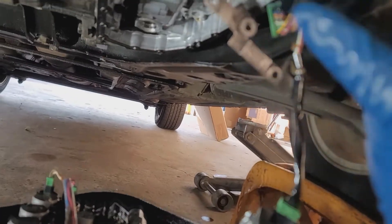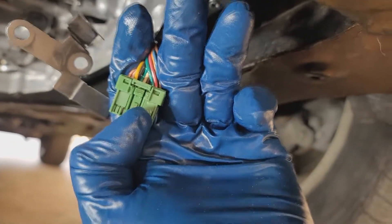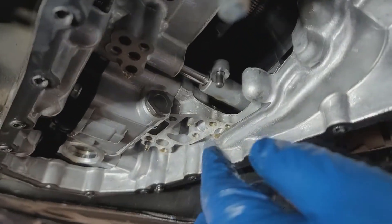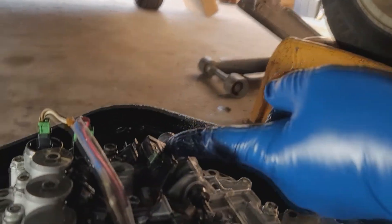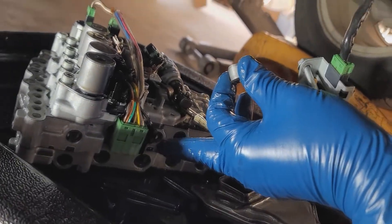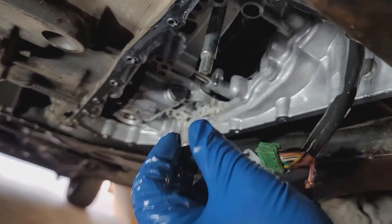Got the valve body off. Just a couple of things — it's a real quick connector, real easy, standard. Little tab, you push down, it connects right here, very easy to come off. This tab here needs to engage up here — that's where it pivots — and it will match, but it has to be locked down. Be careful — it already came off the step motor, because this is the step motor right up here. Also remember there is a sleeve on the shifter stand, and it fits into the bottom of the actuator body. The actuator body goes up there, and this little sleeve goes in there.